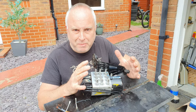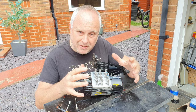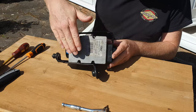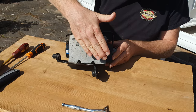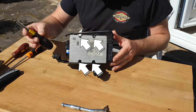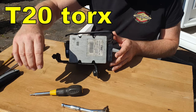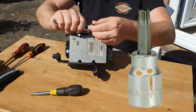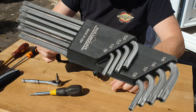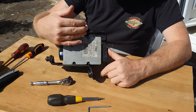From here I'm going to use a spare module and work on it on the bench, because it's an awful lot easier to do and to show you what needs to be done. This is an extremely thorough and comprehensive video covering this repair and other things you can do while you've got the ABS unit apart to help prolong its life — be sure to watch it all the way through. Because of the limited access you won't be able to use a torx screwdriver; you need a T20 torx. My suggestion is a quarter-drive T20 socket on a quarter-drive handle, or a T20 torx allen key.